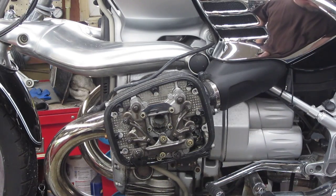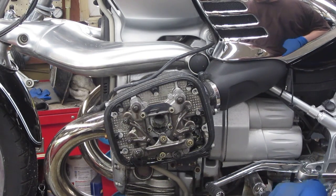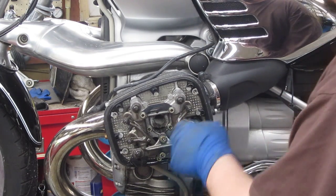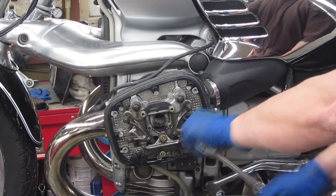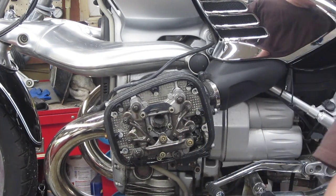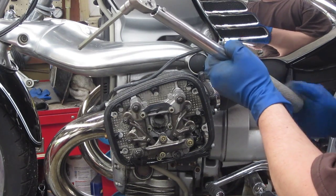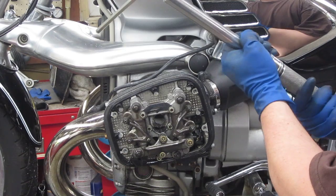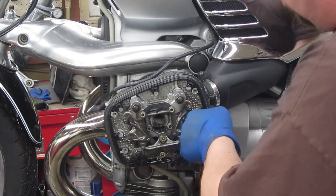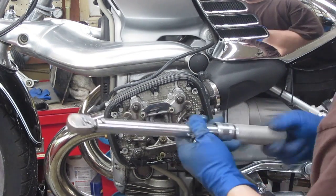These get angle torque. This is the first and only time you would do this, with the exception of replacing the head gasket — and that's a slightly different procedure. This bolt gets re-torqued to 40 Nm, so you're going to loosen it, retighten it, and that is done.